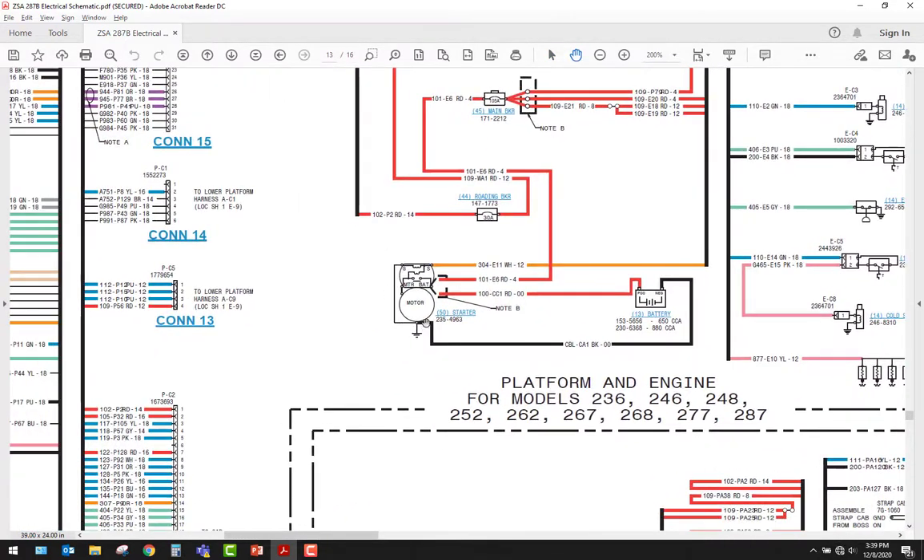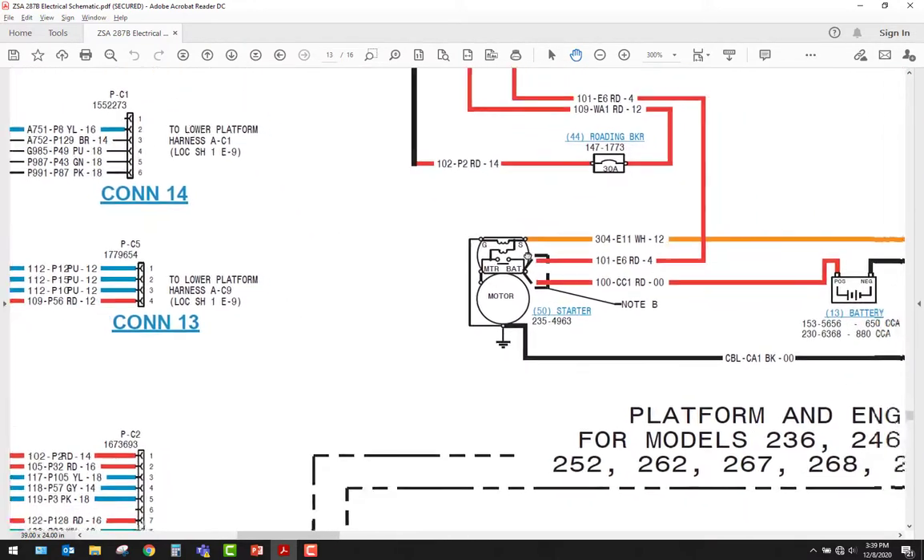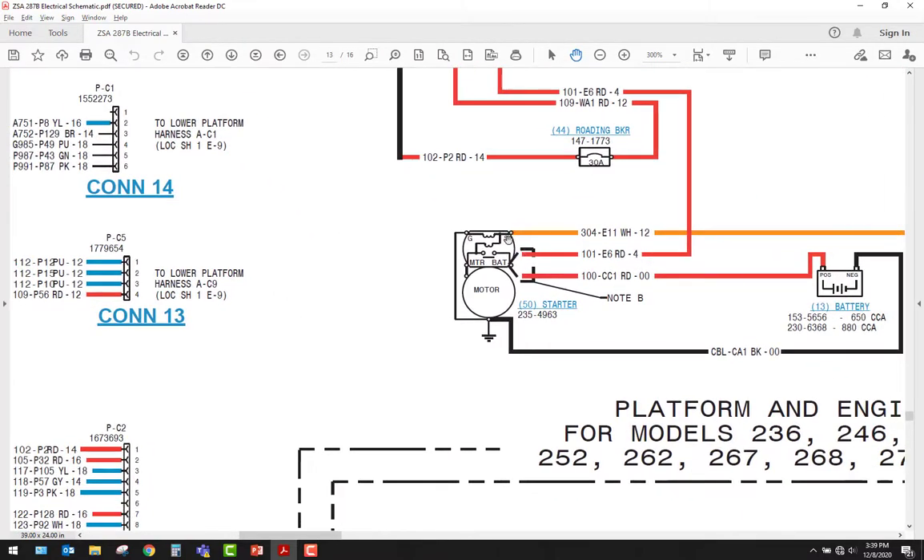Let's start with the starter motor. On top of the starter motor there is our start solenoid. I'll zoom in slightly. The S terminal comes in — we can see one winding hooked to ground, which is your hold-in winding. The one that comes through and hooks to the motor terminal is my pull-in winding. There is the contact disc, so when those two solenoid windings engage, this contact will come up and make continuity, and the motor will turn.